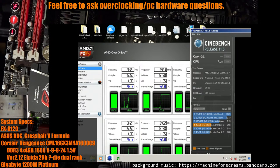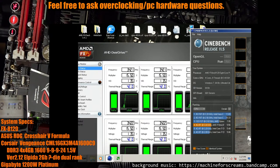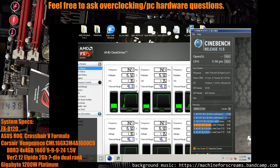Bargain. Yeah, well, it was listed as for parts, not working. As it turns out, the only thing that's not working is two of the CPU fan headers. The seller said the CPU headers aren't working, and I was like, so the power delivery died? I was kind of hoping to have to repair the VRM or something, but as it turns out, it's just CPU fan headers that don't work, which is, who cares? How is that a problem? Anyway,